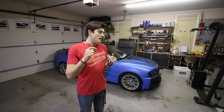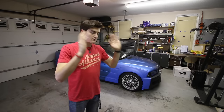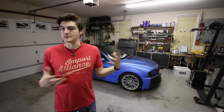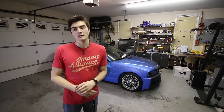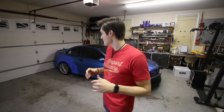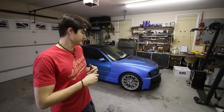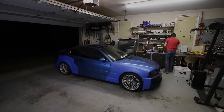I finished off the masking. The next thing is to jack up the car, take the wheels off, put the new wheels on with the spacers, make sure everything lines up properly, and then take a sharpie and mark out exactly what I want the final shape of the fenders to be. I also added a little bit of tape down on the bottom of the rear bumper — I've seen on the Liberty Walk kit it had that little added piece, and I thought it'd be cool to try and incorporate that into the E46. Next step: let's get the car up.